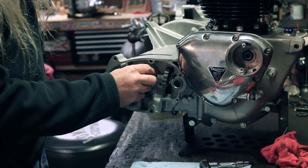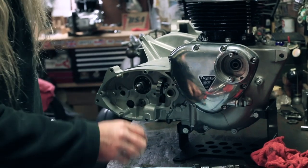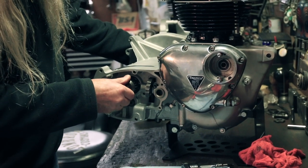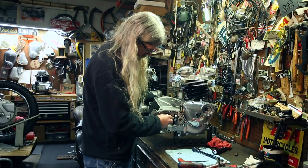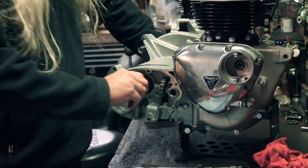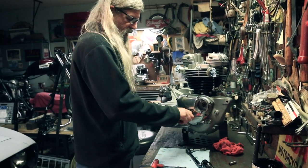Okay, we'll put our kicker gear back on. Washer first. Sleeve with spring. Lock tab. All right, now that we got our gasket and our glue and we're all tightened down, let's double check, verify that it does work before we put the cover on for the last time.